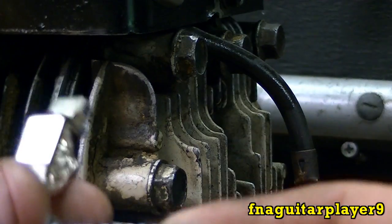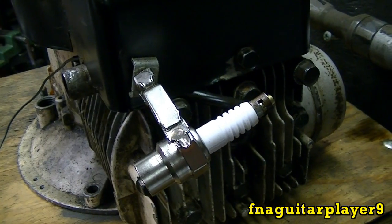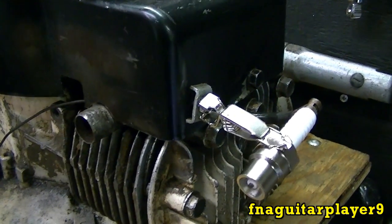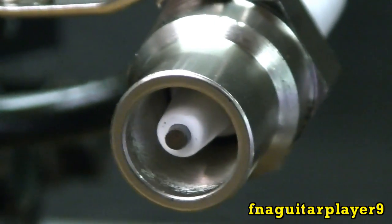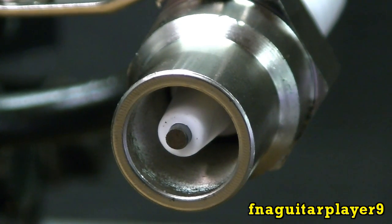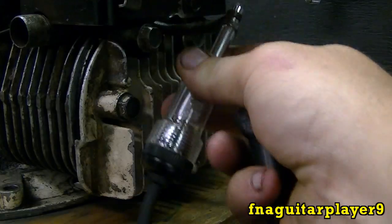Test two is basically the same thing, just a little fancier. The plug wire is hooked up and it grounds out through the shroud — you can clip that to any metal on the engine. You can see that's a pretty big spark gap and it's jumping, so you know you've got a pretty strong spark. This is probably actually more accurate than using an actual spark plug because it has a bigger gap.